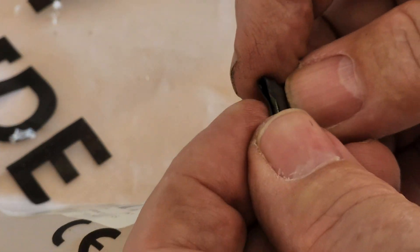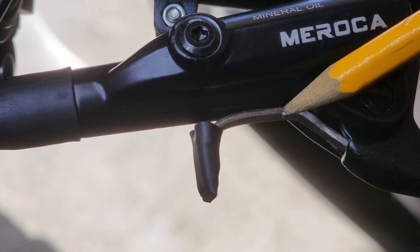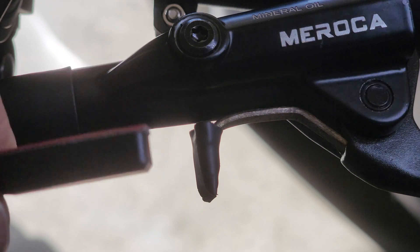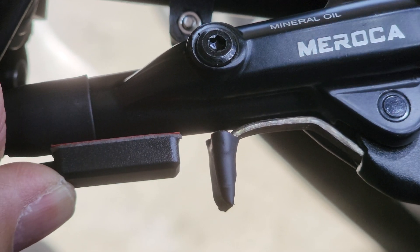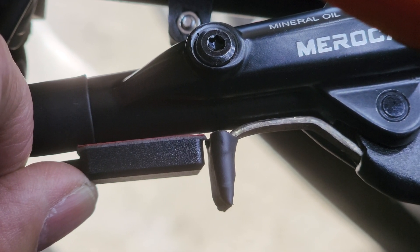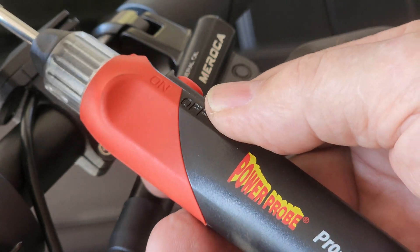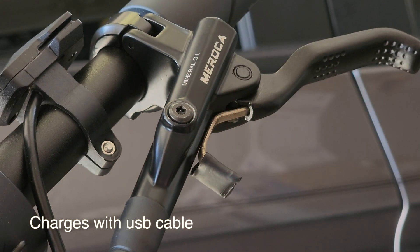Now you have a magnet in a little heat shrink pocket — that's a little better. So to recap: there's a little metal lever that I hammered out and bent right there. This is a magnet with a piece of heat shrink over it, which I'm going to apply heat to. And then this little magnetic switch is going to go right here, stuck to this master cylinder, and the magnet is going to trip it. I'll verify that it works and we'll get to that in a minute using this little soldering gun — actually, this is a Power Probe 50. I really like this little gun — it's USB lithium battery and it works really good. So let's see if we can shrink this.